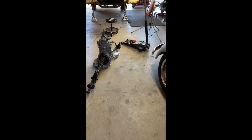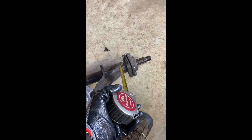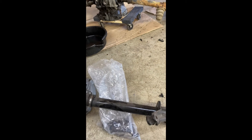A regular '65 or '66 and back measures four and three-quarter inches, so you've got about an inch and a quarter longer on the long axles. That extra length is because of the distance to the tire — if you put short axles in, your tire will be an inch and a half inward, and you'd need a really thick spacer for your wheel to sit where it's supposed to be.